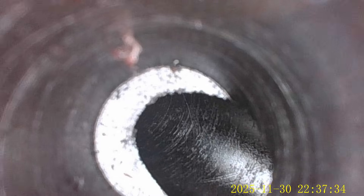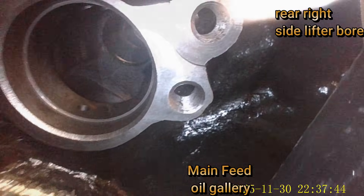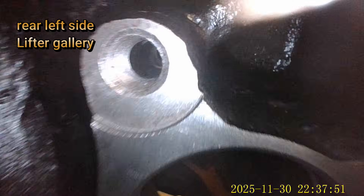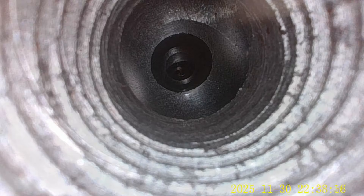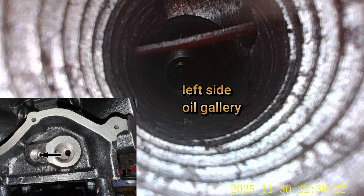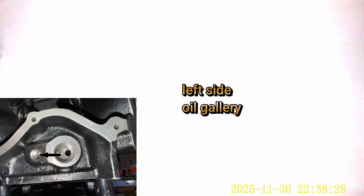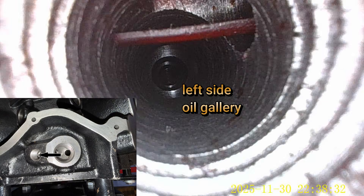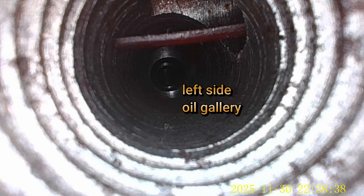Here's the ones in the back: the lower one feeds the mains, and the top one goes to the right side lifter bore. Same thing — this is by the distributor. Look right here, we'll go inside that. I'm going to that little hole right there down in the top of the block on the left side — the smaller one — and that's where it crosses over. So the oil from the right side crosses over at the top of the block, comes down this port here, and that's what feeds the left side oil galley.